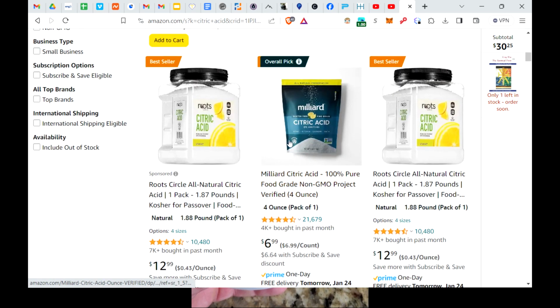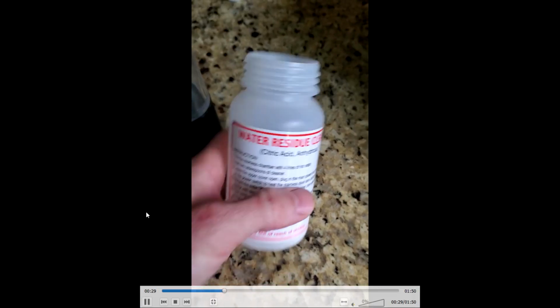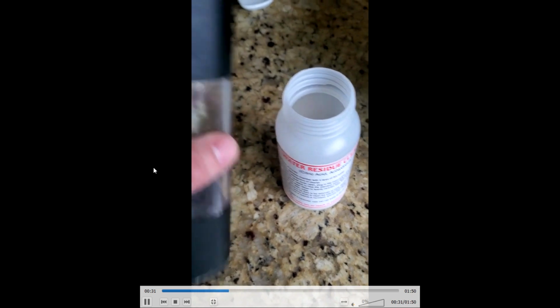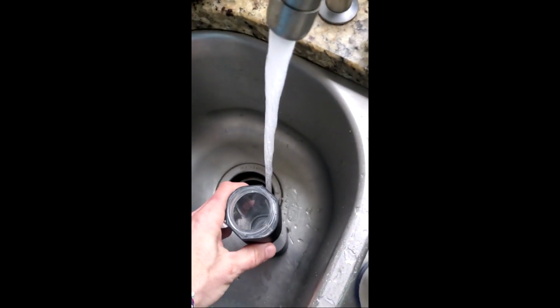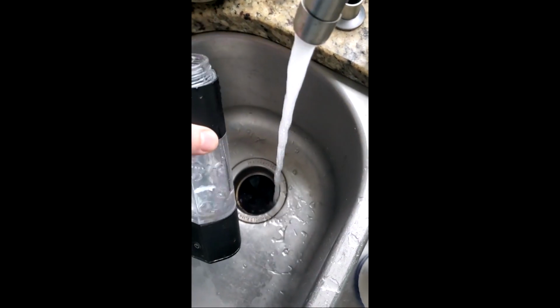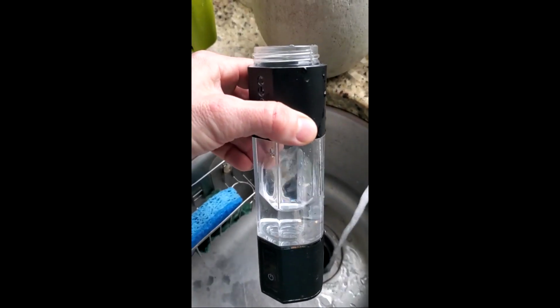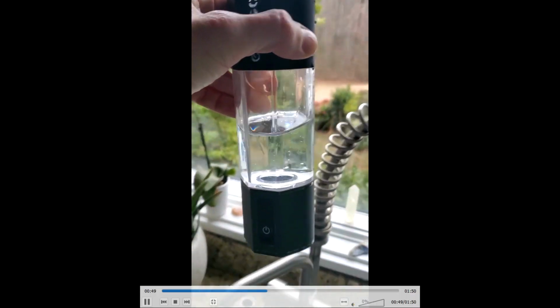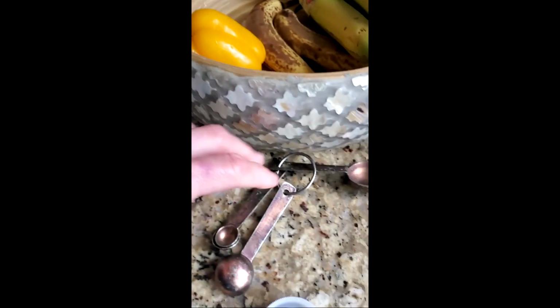And so when you mix that into solution, what that is going to do is it'll increase the acidity of the water, and citric acid will actually help with taking the minerals off of the plate. So how much water do you need? Not much, because if you use less water, you have a greater concentration, right? You don't need to fill the whole thing up. It just has to touch the plate at the bottom ultimately. Once you make a citric acid solution, pretty easy, right?